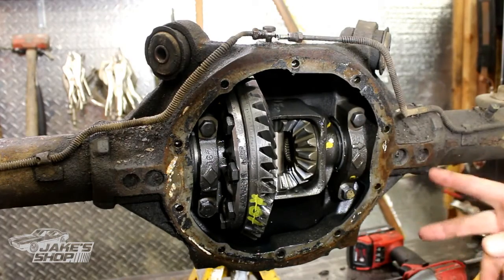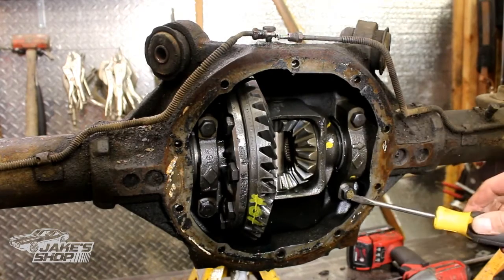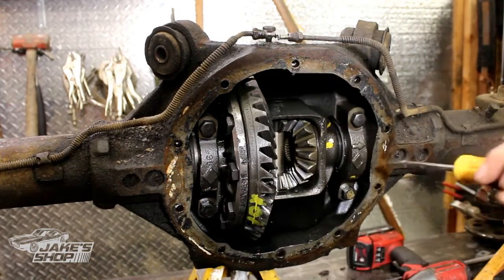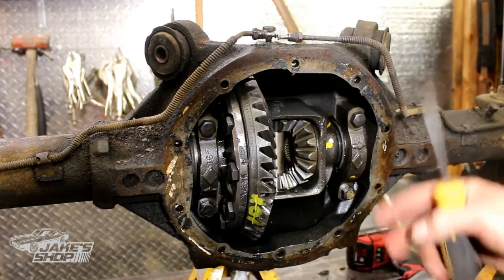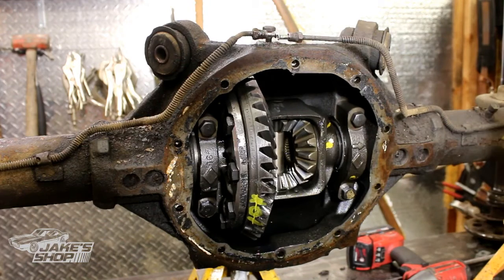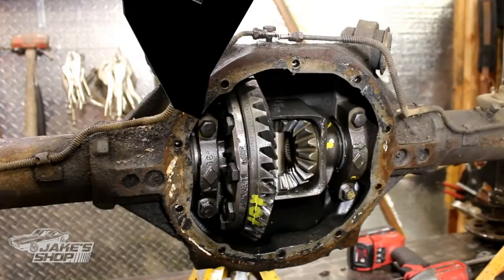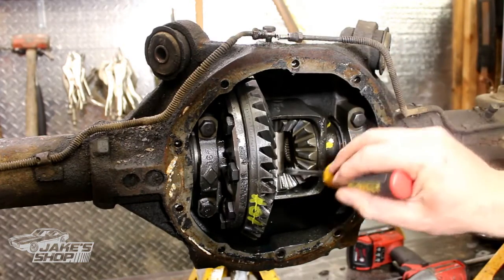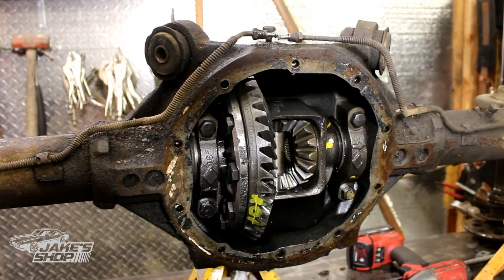This is the differential. Something key in the entire build process — you can see the bearing caps on each side. There's an arrow pointing out and an arrow pointing out. Those should go back in the exact same way we take them out. You just unbolt these bolts, pop the caps off. Most times the differential is pretty well wedged in there — you can lightly tap it with a mallet or stick a couple of pry bars in to wedge it out. One of the big reasons I'm changing the differential out is because it's an open differential. There's no springs, no clutches — it's not a locker or posi or anything of the sort.